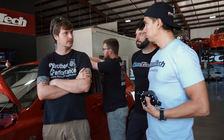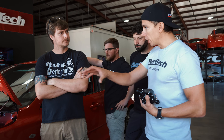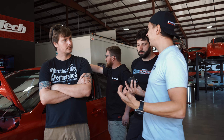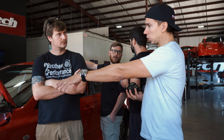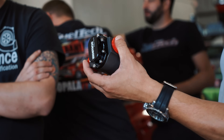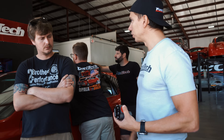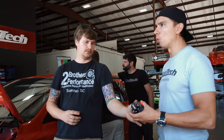Can you move the fuel cell to the front? I would do that — move to the front, you need the weight down the front anyway. Because of the assembly, the motor is kind of tall, the pump's still going to be up, so your fuel cell won't be above the pump, it's going to be below. I'll still run a primer just to crank easier, but you actually wouldn't need it — it's just to be extra safe, crank quicker. If the fuel cell is closer to the pump, you have a nice feed line. This one will support that power — like 2,000 horses easy on alcohol. All the power from the battery can focus on injectors and coils, not wasting on the pump.